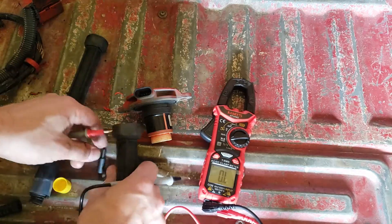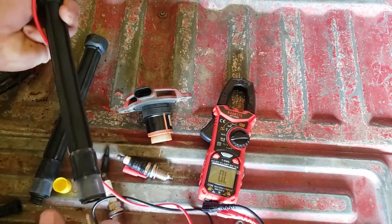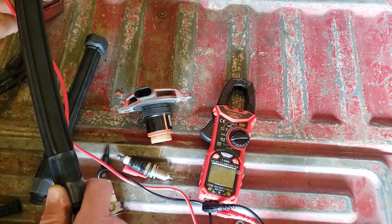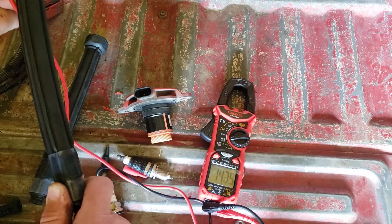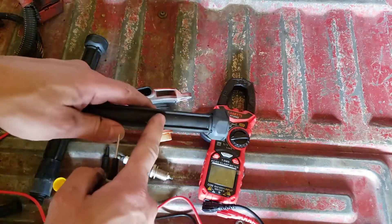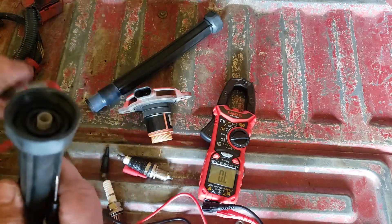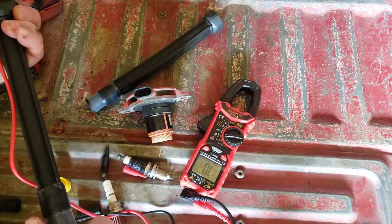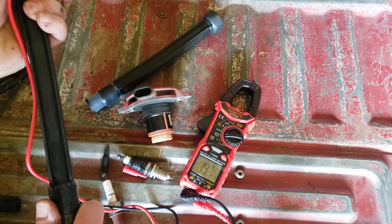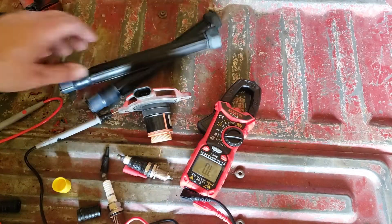Pull the covers off because they've got nice little protectors on them. You can check from pin C to the end of your extension. This extension is bad — as you can see it's jumping all over the place: kilo-ohms, mega-ohms, ohms. 20 ohms or less through your extension is the spec; this is obviously way out there. Let's try the other extension — also a bad extension. Extension part number 4389407 from Cummins; both would need to be replaced with new ones.